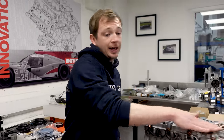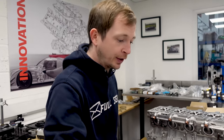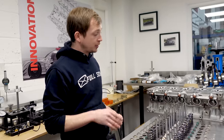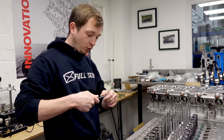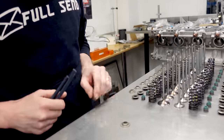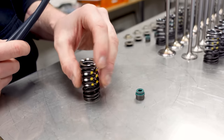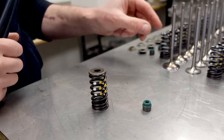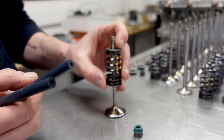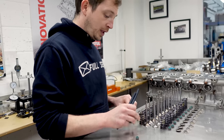We've got a Lamborghini head to put together. I think we've shown stripping them on the bench but we haven't shown how we put them together. So apart from the fact it takes me longer to lay everything out than it does to put it together, we thought we'd walk you through what we do. We've got to put the spring seats in, then the valve stem seals go on the top of the guide, then the spring seat goes in, then the spring, then the retainer.